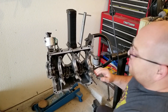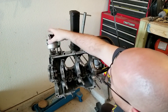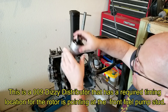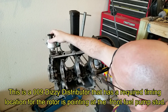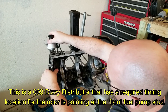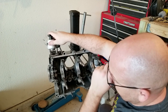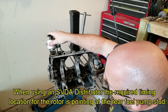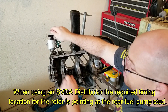One of the main things to know whenever you're doing your distributor drive install is to have your distributor in place. You've got the distributor in place so that it helps hold the gear down, because when you do the install and you're dropping your crank on here with the bearings, the drive gear will float up if you don't have your distributor in here as well. Also you want to make sure that you have your little anti-chatter spring in there — that keeps everything in place and allows the distributor drive gear to stay down. That's one of the key things you need to know about your distributor drive when you're putting it in.